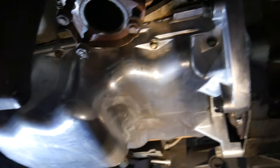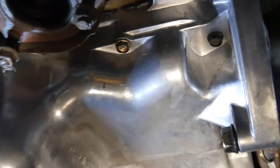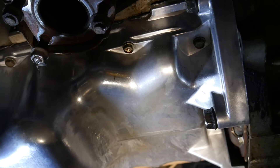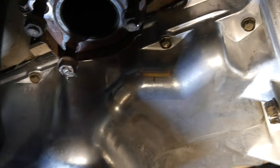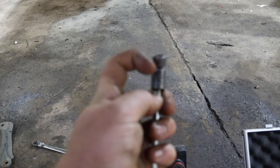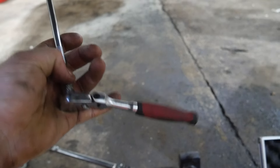So we got the pan in. At this point I like to go around — you can see we just have a bead of silicone just barely squishing out of that seam there. That's how you know you got a good seal. Some people on YouTube will say you put way too much silicone on there — but this is how I've been doing it for years and I've never had a problem. We had lots of issues at the dealership redoing things from the factory with not enough silicone. So I go around and check for a good, consistent bead everywhere. Next, we're going to go around with this Mac Tools quarter inch swivel and double check — go around the oil pan twice and make sure everything's nice and tight.